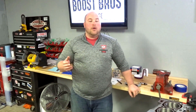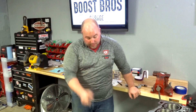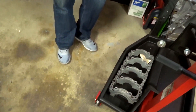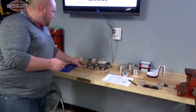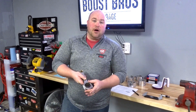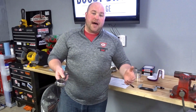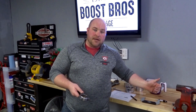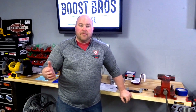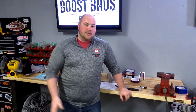In our next video we'll be going through and measuring the diameters of the journals on the crankshaft. We'll be putting the main girdle on the motor with the main bearings in there and measuring the inside of that to get our clearances. We'll also be putting bearings in our rods and measuring those as well — that's what's going to give us our important clearances for our crankshaft. Once we have that we can file fit our piston rings and start assembling the motor. Stick around for those videos. If you have any comments put them down below, check out our social media feeds, and like and subscribe. Thanks guys.